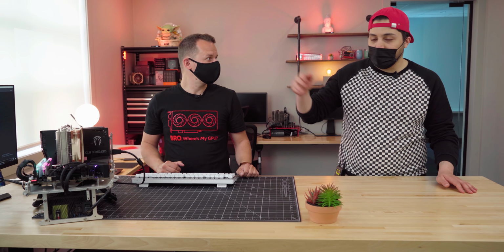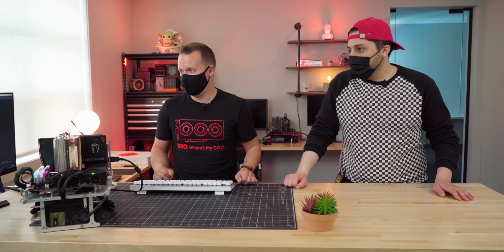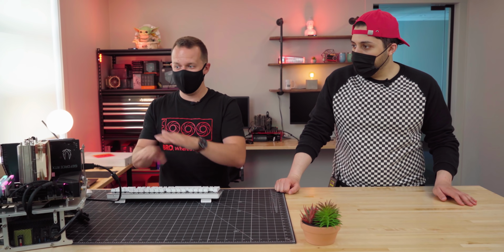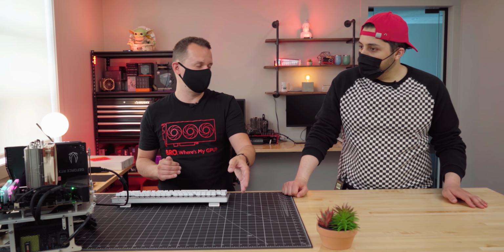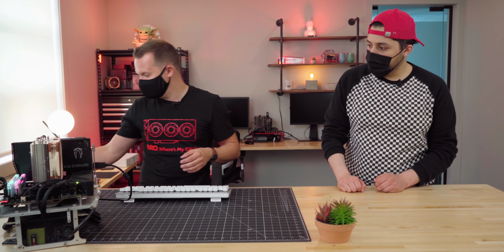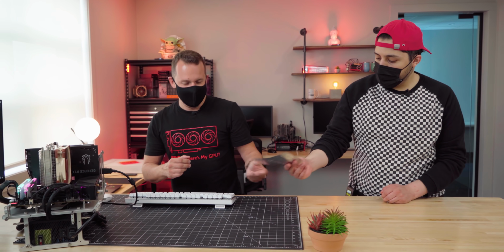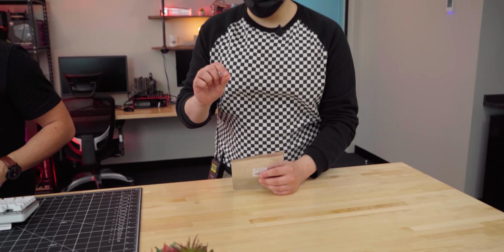I thought it would skyrocket and burn itself out. No, but it basically didn't. So at least now we know what happens when there's absolutely nothing between the IHS and the cooler. What's going to happen now is we're going to take this apart. I'm finally going to give this to Snows to start cutting, and we're going to actually use the Indium now to see if his prediction is correct. I'm shooting for as good, if not just a little bit worse than the thermal paste.